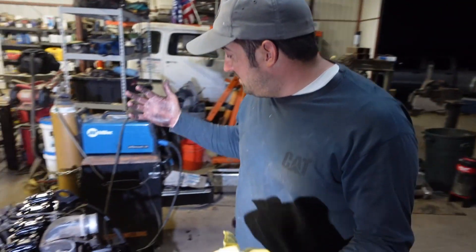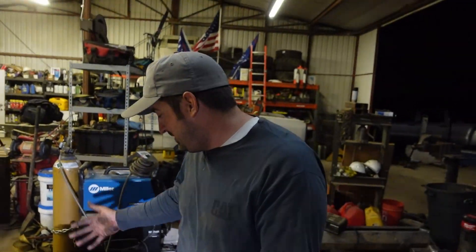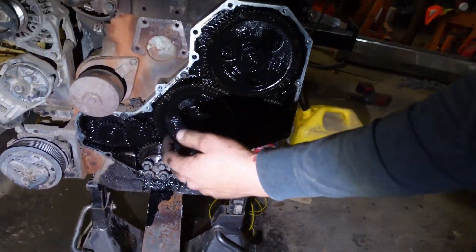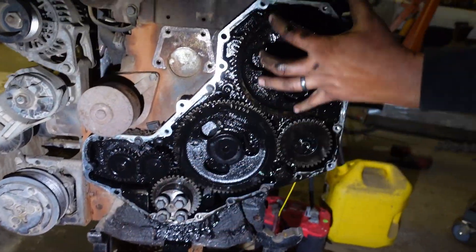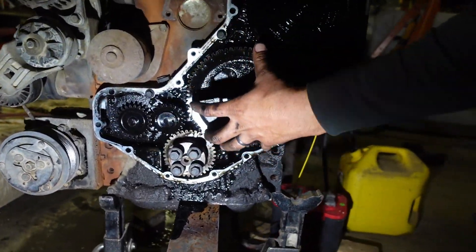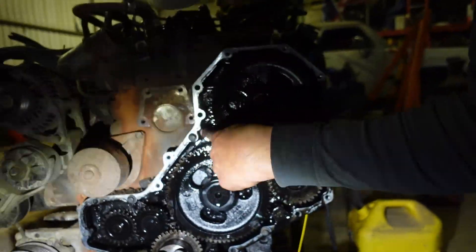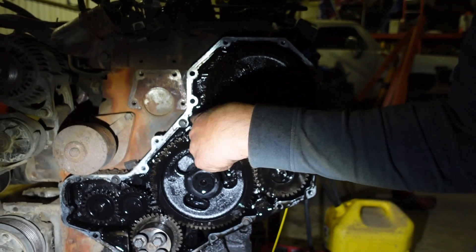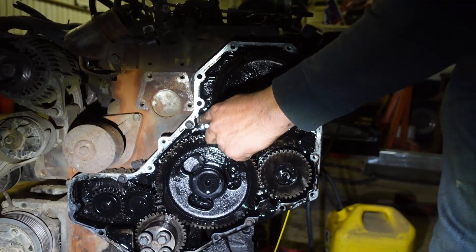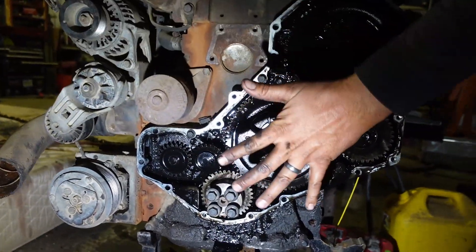Typically I have a way better engine stand, but we built this one so we could actually show you guys this. We're gonna start it up so you can see how the actual gear assembly rotates and how fast it rotates. The gear assembly is super cool because it can never really get out of adjustment. The only thing that can kind of kill you is this killer dowel pin right here — if this comes out, it drops down and blows the casing out. That's the Achilles heel of this whole engine.